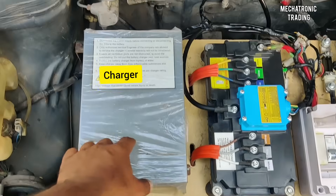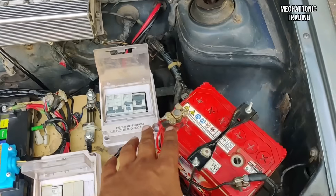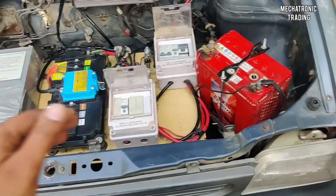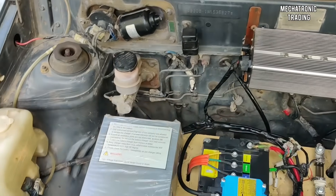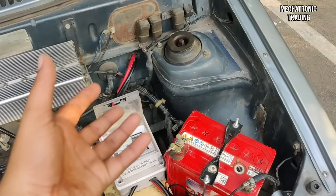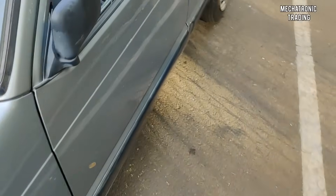This section is the charger — it's a 60-volt charger as we have a 60-volt battery pack in the vehicle. This one is the DC-DC converter. The existing 12-volt battery in the vehicle acts as an auxiliary battery only — for indicators, headlights, horn, the wiper motor, and other electronics required for the vehicle. The DC-DC converter takes power from the 60-volt battery, converts it to the appropriate voltage required to charge the 12-volt battery, and we've set the current so that this battery gets completely charged in the perfect manner.